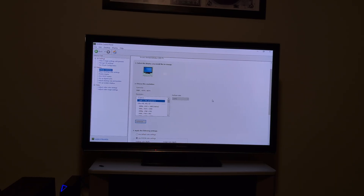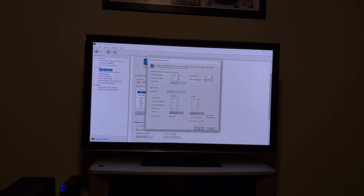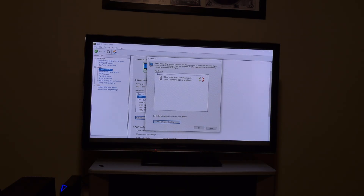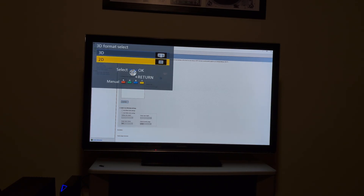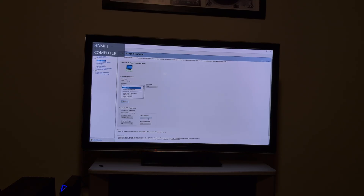So what we're going to do next — by the way, we're using HDMI — since we're actively on 720p at 120Hz, we're going to try and create the 1080p at 120Hz now. All we have to do is create a resolution and type in 1920 by 1080p. Test. See? It works — it just works. So we hit OK, go in here, hit Apply. We're now at 720p 3D to take advantage of the 120Hz.